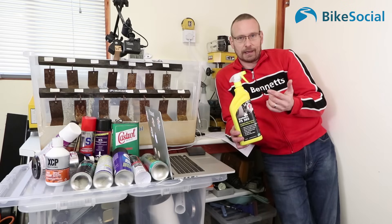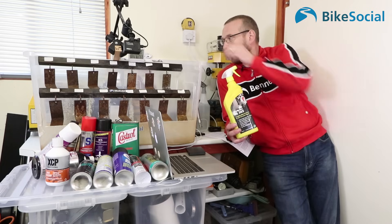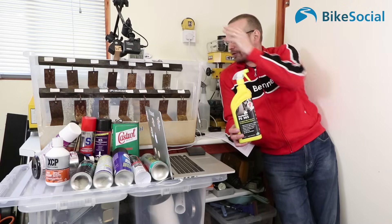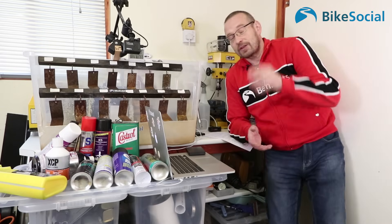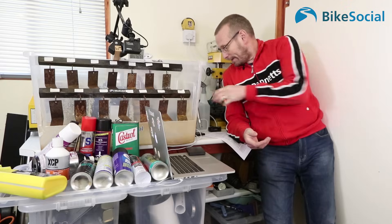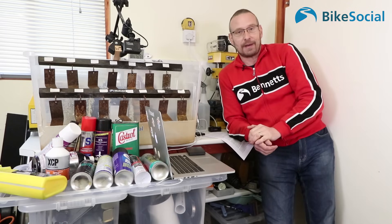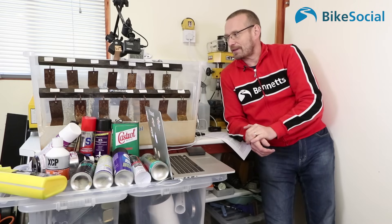So in the morning I'd salt spray, in the evening I'd salt spray, then on the FS365 re-coat plate I'd give it one coat to reapply the product. The other FS365 test I just sprayed it on once and left it. ACF50 I did with a paint gun and compressor — that's how I put it on my bike — and also with the spray can, and the same with the XCP. You can buy that in a bottle so I put it on with the compressor and also with the spray can.